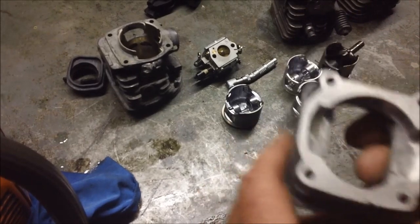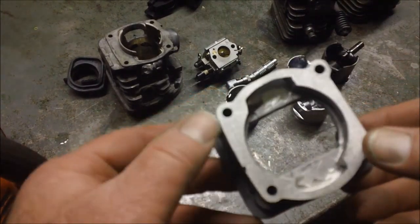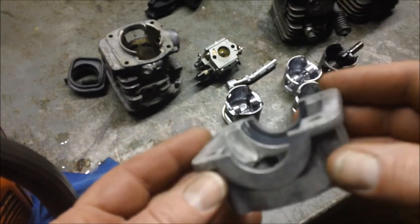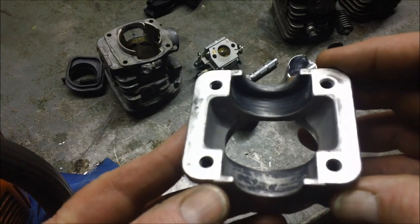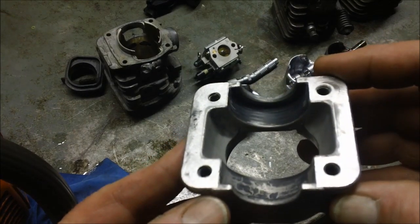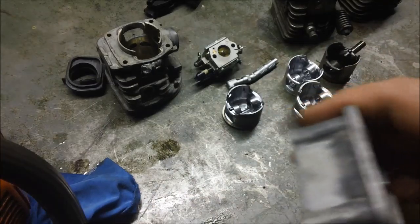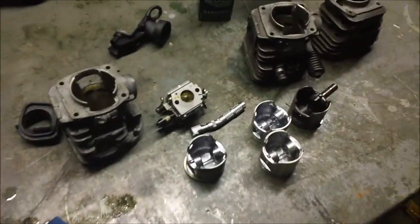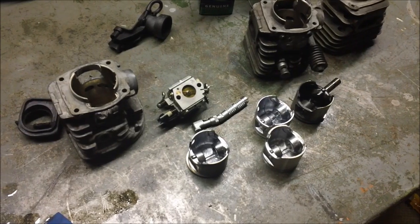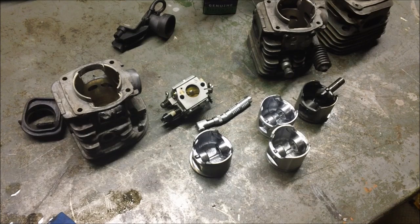First, bearing caps. And I had mentioned this in my prior videos. Some have fine thread and some have a coarser thread set of screws or bolts that hold them together, hold them to the plastic case and also hold the cylinder. This saw here had the coarser ones. So when I put it together, I pretty much glued it together with a 3-bond 1194. Hopefully those screws don't back out.